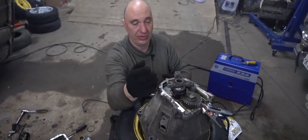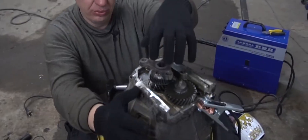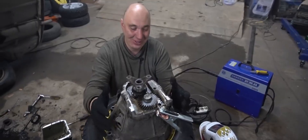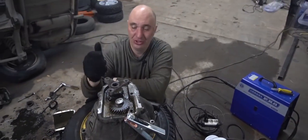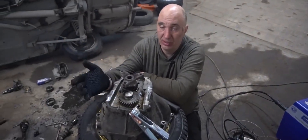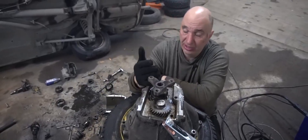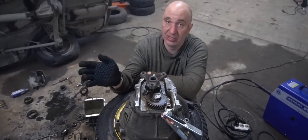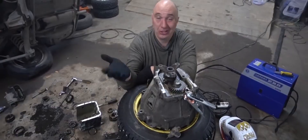Here's the situation with the gearbox. You might be wondering why I welded on a flange — that's so I can bolt on a rubber coupling, which used to be installed at the back of the gearbox anyway. But since it has been shortened considerably, we are left with just the bell housing and a small piece of the input shaft. This was done in order to be able to run a clutch. We want to be able to start the car without it taking off straight away. We are running a direct drive straight from the motor, with torque being transferred right to the drive shaft.